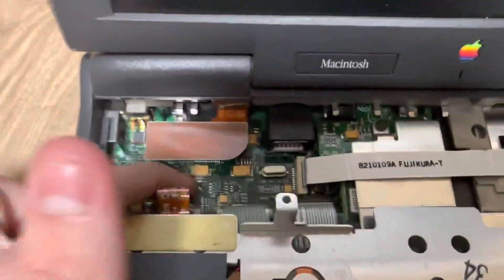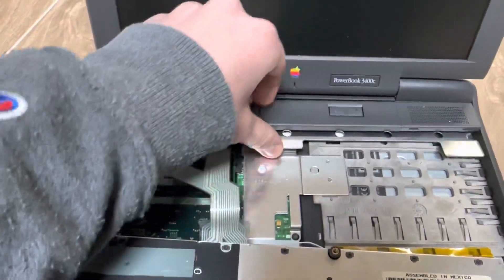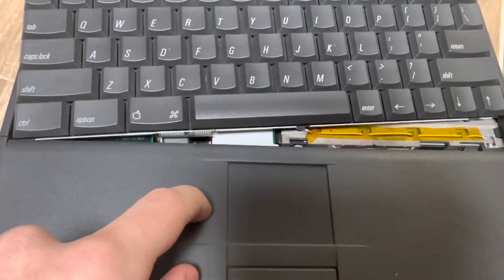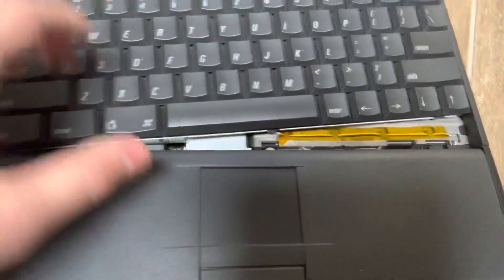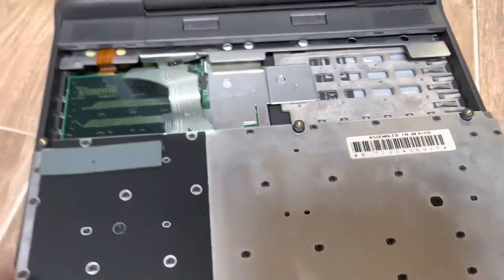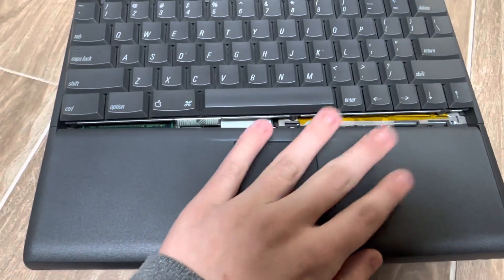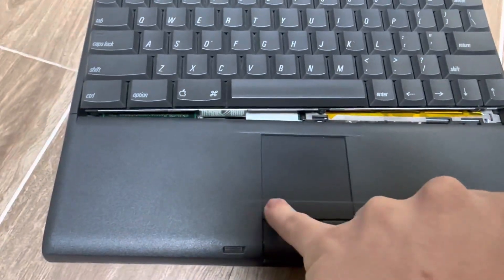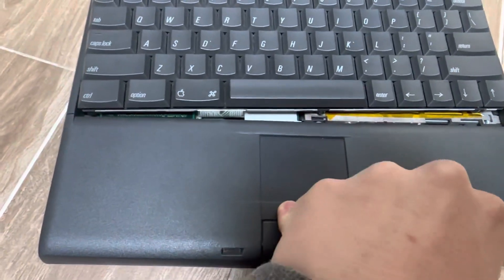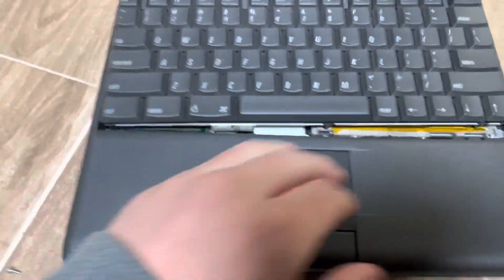If you have any corrosion, it'll likely have gone down there. The cable will run through here under the palm rest into the DC power board. It's not completely necessary to remove it all the way. There is a disconnect right around here, but it may be difficult because the first place the corrosion goes is it wicks up the connector — that's how it was on mine. I removed it at the power board because I was removing that piece, but it's a lot more difficult. So there may be a little bit of corrosion in the connector on the power board that you might want to check out. If you just want to do a quick fix and you're planning on swapping out a different hard drive later, you'll have to remove this anyway.